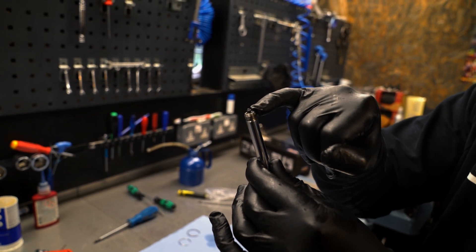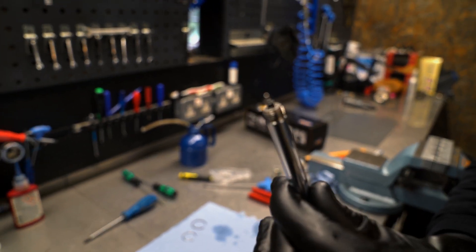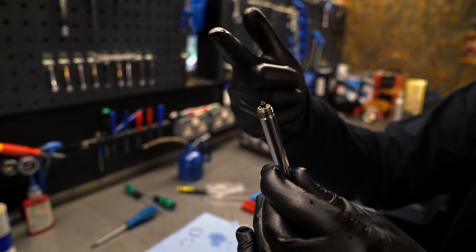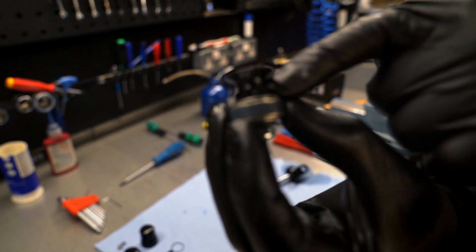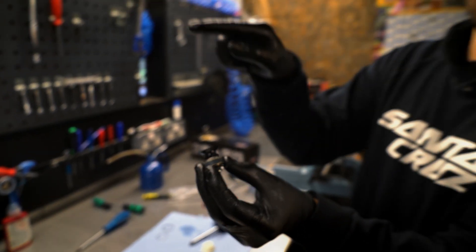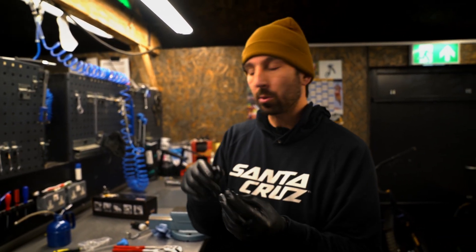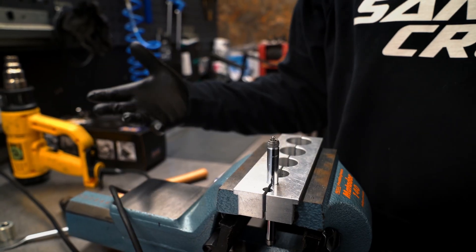You can just see there's a little angle on this needle. That is the thing that adjusts the flow of fluid back through the piston on the rebound stroke. The further that rebound needle is protruding into this hole, the more of the hole it covers, the more restriction there is with the fluid coming back on low speed rebound. High speed rebound has a separate circuit. Some people call this an adjuster shaft or a metering rod.